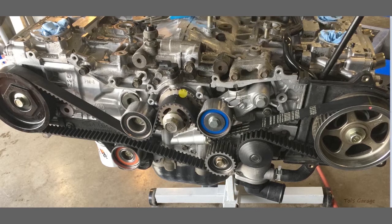The timing belt has a dashed paint mark right here. The dashed line paint mark is positioned on the crankshaft sprocket timing mark, just like shown in the picture. The timing belt also has two other painted marks that are solid lines. The mark that aligns with cam sprocket number one is 44 teeth away from the crankshaft sprocket dashed paint mark. The other solid timing paint mark on the belt for cam sprocket number two is 40 and one half teeth away from the crankshaft sprocket.